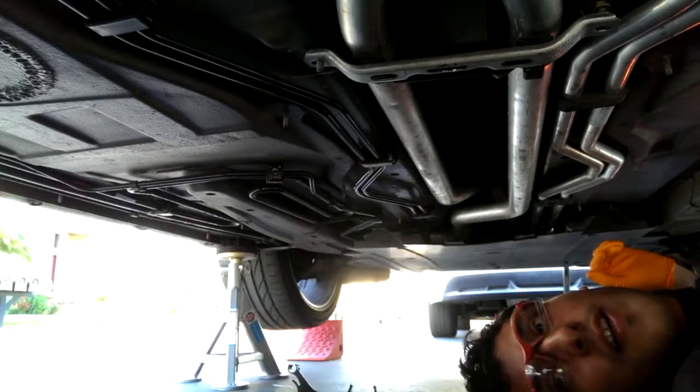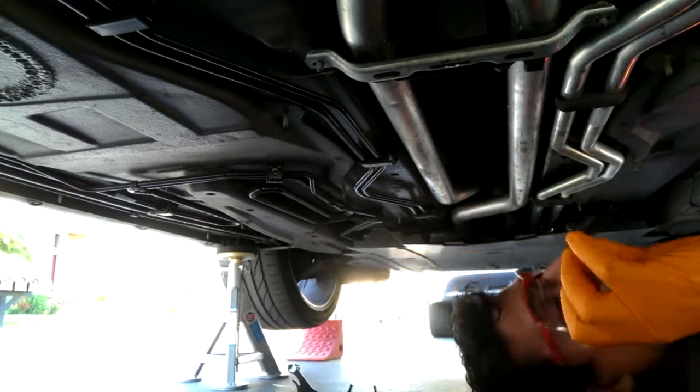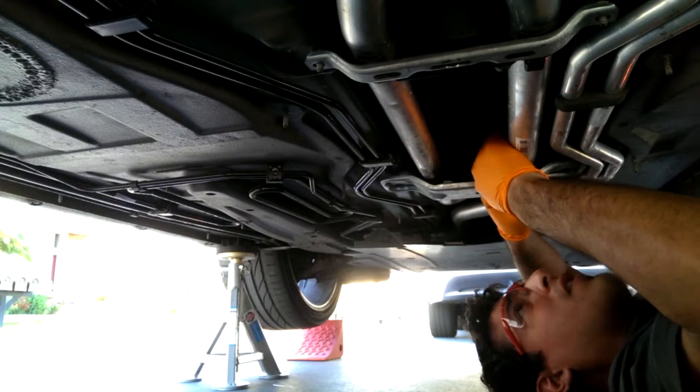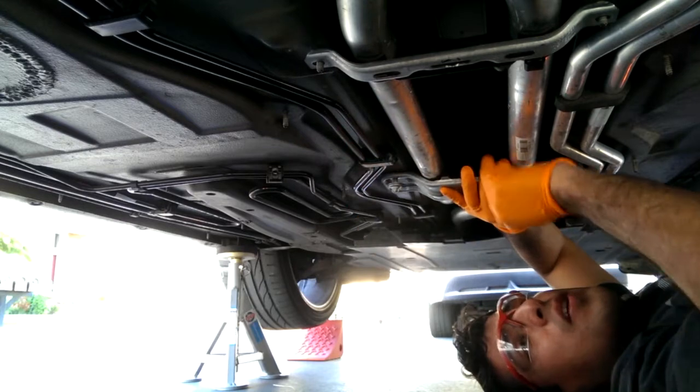We'll call that dimension — so that's edge of the tab to the beginning of where its hole should start, that way you can tighten it up and it will be square. Tab length to first edge of the hole is 10, 15, 16, 17 — and we'll call it 20 mil on the other side. This baby's almost ready. Right now all I have to do is drill out the holes where they're going to attach to the factory frame. It's going to go in here at these factory hose braces. In order to do that I'm going to put all the fasteners back in and torque them to get the hoses in the correct positions, because one of these flexing will affect the other.